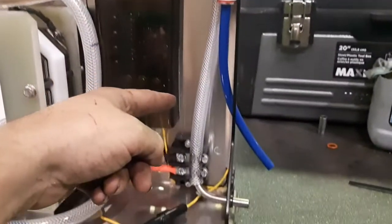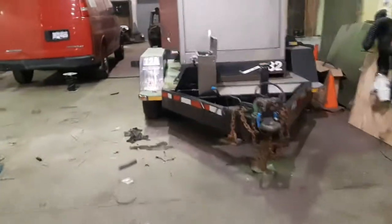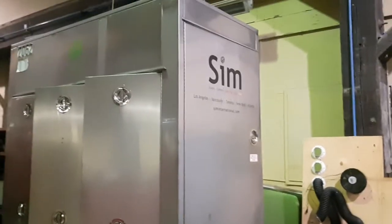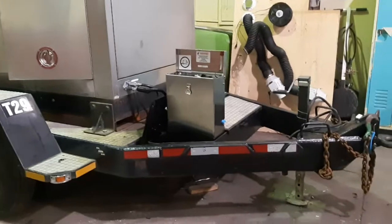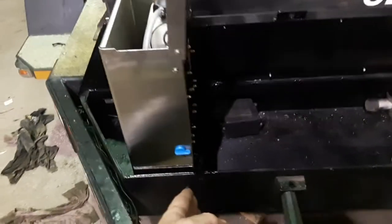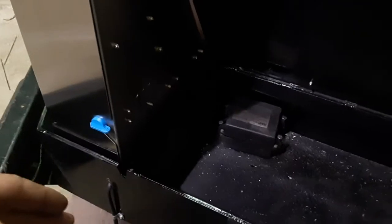The hydrogen then comes out of here and runs down this hose. Now with this system, these boxes are kind of generically designed — they weren't designed exactly for this application. This movie generator has a big Cummins diesel engine in it, and I had to make significant modifications to make this work. This used to be a toolbox that went all the way across; I cut the lid and installed another wall, so it's basically a functional toolbox on one side still, with the unit mounted right here.